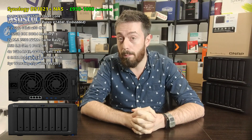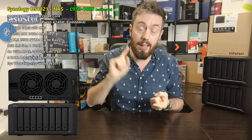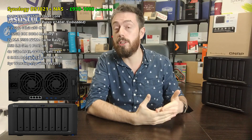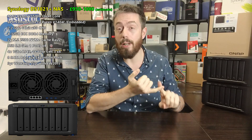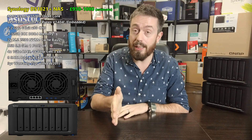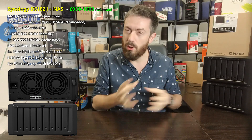It also arrives with support for Synology Hybrid RAID (SHR), which is fundamentally useful to Synology buyers with that fluid RAID system. The system also supports traditional RAID configurations like RAID 5 and RAID 6. An 8-bay system allows you to have that two-disk safety net in the background. SHR is also available as a two-disk version in SHR-2, and you can even go for triple parity with some of the smaller configurations.